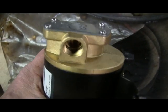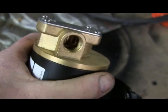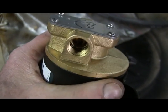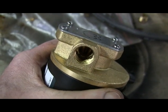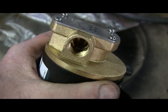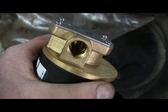I noticed inside one of the ports there's some brown crud. The other side's fine. I wasn't sure what it was — whether it was gasket glue, caked oil, or what. So I took a pick in there, scraped it out, ran it through my fingers, and it's very gritty and it sparkles with brass.